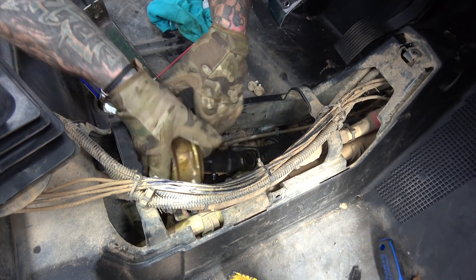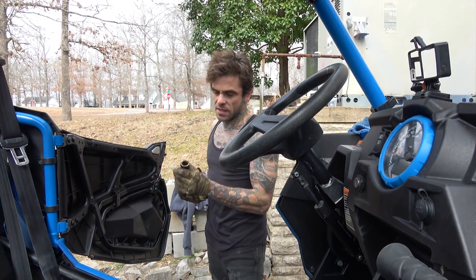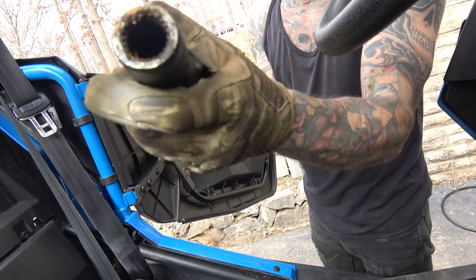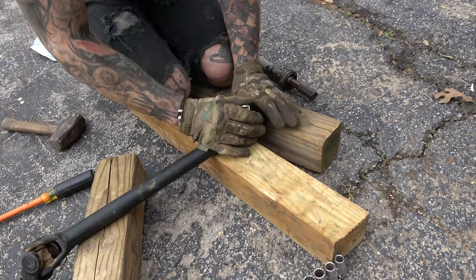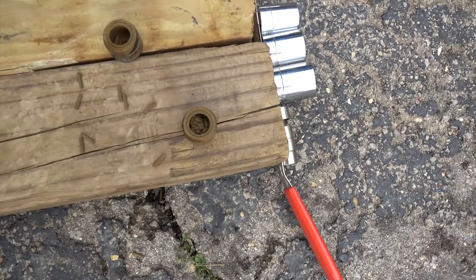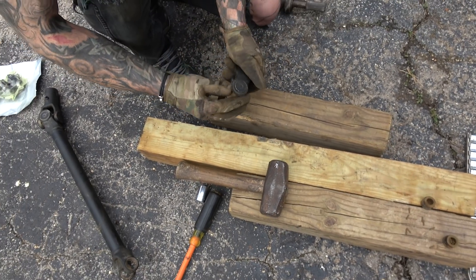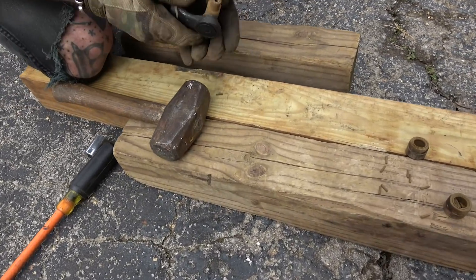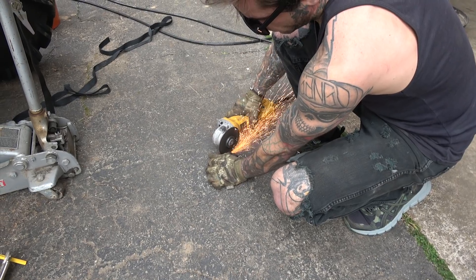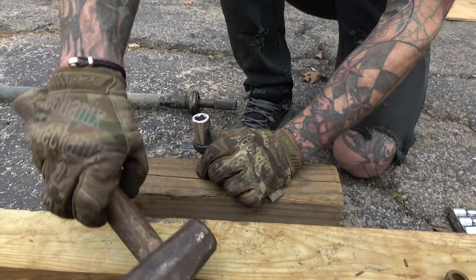Let's see what kind of damage we did in here. The carrier bearing is locked up — not good shape at all. That old ring is what was holding us back; it's probably torn a little bit. These U-joints are from Sandcraft Motorsports — nice and dusty, but those things need to be able to be greased. I don't get why they don't make them that way from the factory.